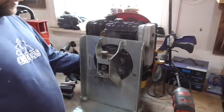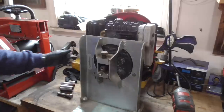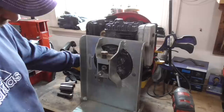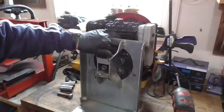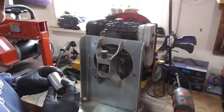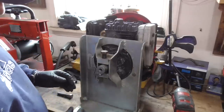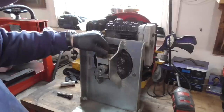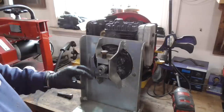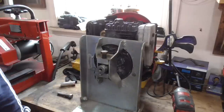What's amazing is how bent this thing is. You can take a look at that crank and see it's very bent. The first thing we have to do is try and slip the sleeve on here. This thing comes with different size sleeves — I think this one's a 7/8-inch. We're going to slip that on there, and we'll have to tighten this bolt up here because it's so bent I can't even turn it over with the sleeve all the way in.